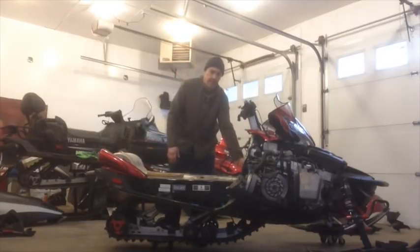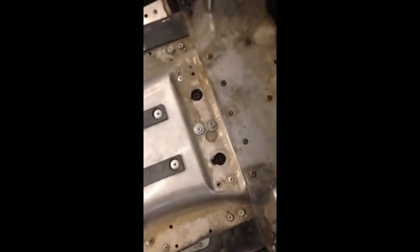So then you got an exhaust panel inside here. Slides out. It's a snug fit. That comes out. There's your exhaust donut. As you can see, got 1 damaged one here. Got a crack in it. Drilling these 10 rivets. Don't even bother trying to undo them. Even if they do hold, they will just break the bolts. So just drill those 10 rivets. That way it drops right out of the bottom, and then we fix it on the bench after, which I'll